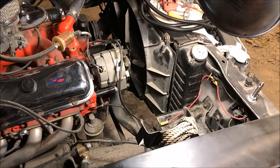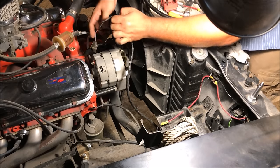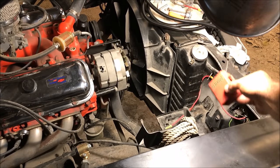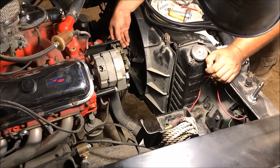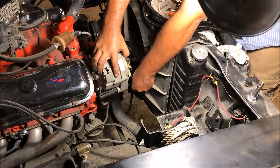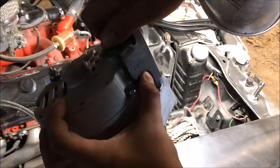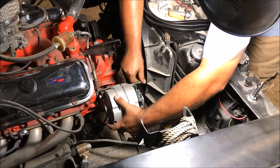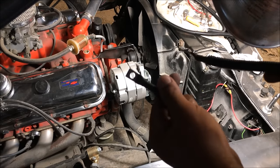All cars will be a little bit different, but this is a 1970 Chevelle. We're going to start by taking the ground off the block. We don't need the factory alternator wiring at all - we're going to completely remove it. We've already removed the battery because we're going to mount our junction block somewhere right there. We're going to remove the alternator and put the new one back on. It's a 10SI three o'clock position - 100 percent the same case.